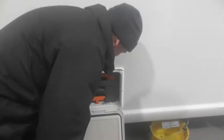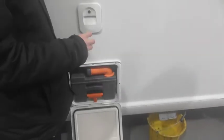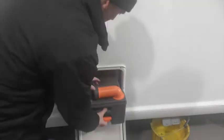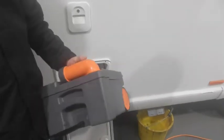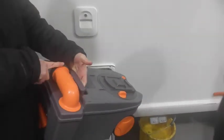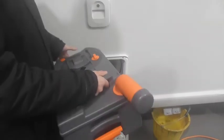So this cassette will be different. To release it, just lift on its handle and it should slide out easily. If it's not sliding, the waste gate is still open on the toilet — push it back in, go and have a look; the kids might have left it open, shut it, then slide it out. It's a smaller one but you've got wheels. Obviously makes it a lot easier when you need to go and empty it. Mechanism should be the same — so blue chemical before you use it and around about a pint of water; that helps break down the nasty stuff. When you go to empty it, the cap comes off — exactly the same.